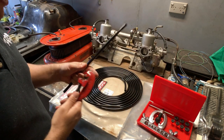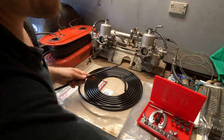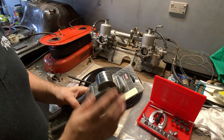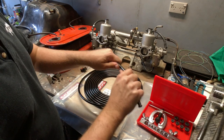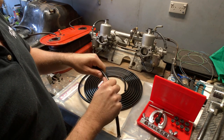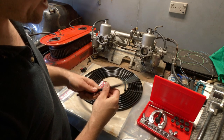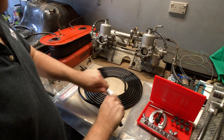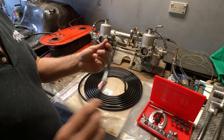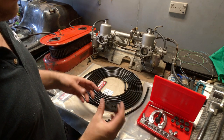The other tools I've got are a plain old cutter — which cuts the aluminium very quickly in two or three rotations with little force — and a proper form-fitting pipe bender. This stuff seems to be fairly bendable by hand. You wouldn't want to bend it backwards and forwards too much, otherwise you'll get strain hardening and potentially weaken the pipe.